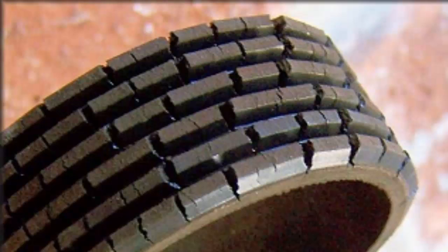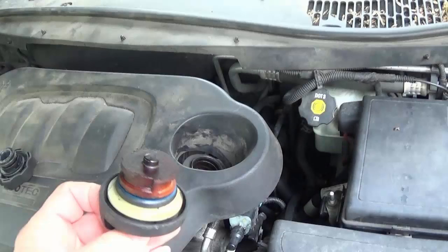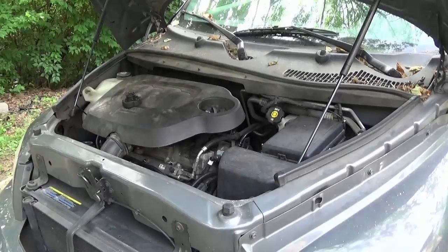Never doubt your senses - when you pull the oil cap off, smell it for antifreeze or gas. On an older car with a fuel pump bolted to the motor it can leak fuel into the engine; if it's fuel injected it could be leaking gas down into the engine through the injector. Smell the cap and see what you smell. If you don't smell anything, it's probably good. If you smell just oil, you're probably pretty good on that one as well.